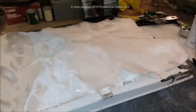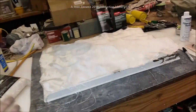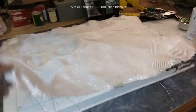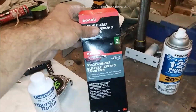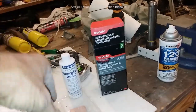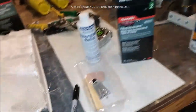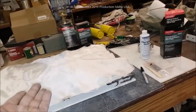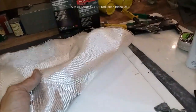Instead of spending a hundred dollars — $16, two hours of your work versus $100 for one of these things. It's just a piece of cast fiberglass plastic, really cheap, but they've got you and they know you need it. You can hit back by just repairing the one you've got. These Bondo kits are great for all kinds of stuff — I just did the rear end of a '76 Cadillac that has plastic fender ends, redid that with two of these kits because they wanted $600 for those new old stock plastic ends.